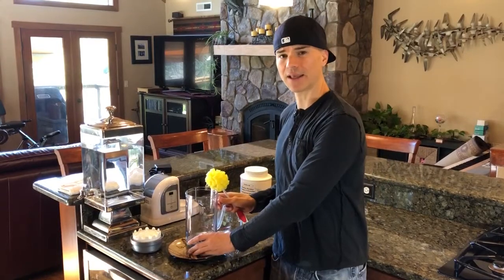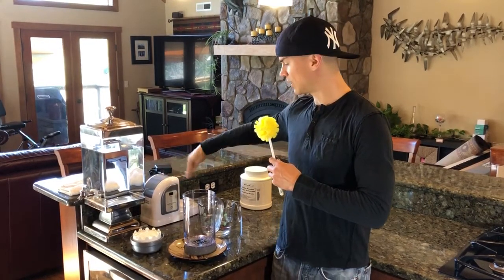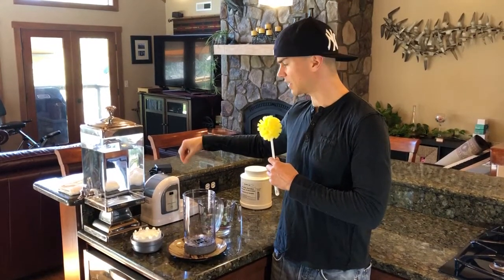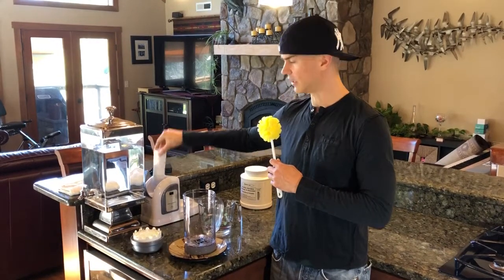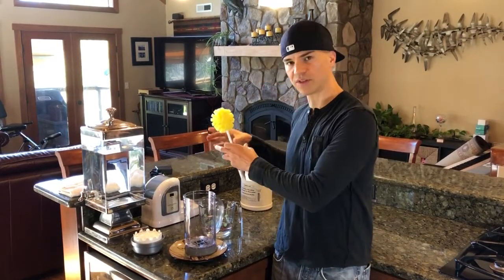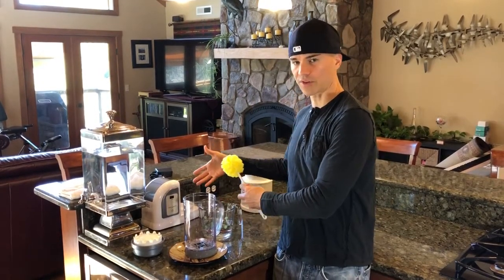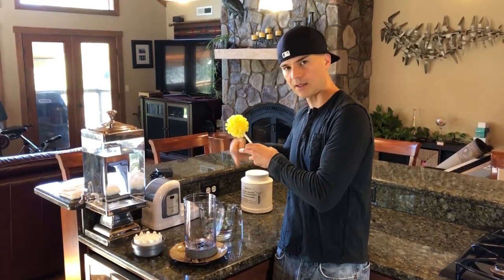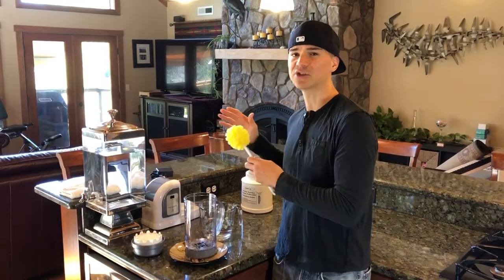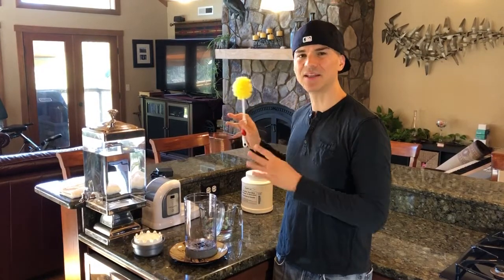Once that's done, that's pretty much it — unless you want to go above and beyond. With the unit itself, you can drain it and clean the basement area where a little puddle of water sits. If you drain it, use a paper towel or Q-tips to get any dust out. You can even remove the filter to clean around different areas of the unit. When moving the unit, move it very slowly so you don't slosh water around or damage anything. You can bring a bowl over and lift the unit carefully to pull the plug and drain it — which is also useful when traveling. Make sure it's really well drained, and don't touch the pins with your hands or try to scrape them. Nothing needs to be done to those pins.